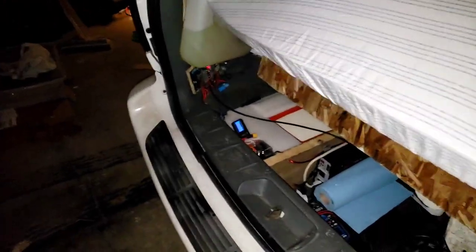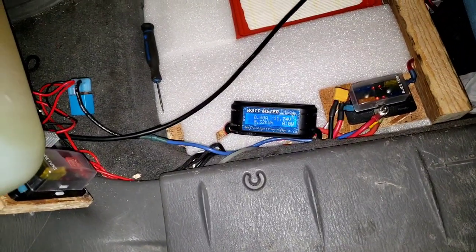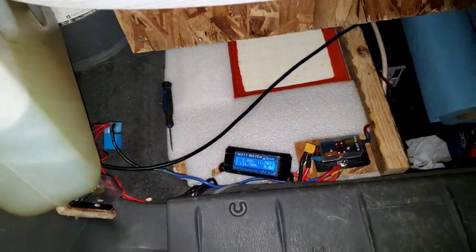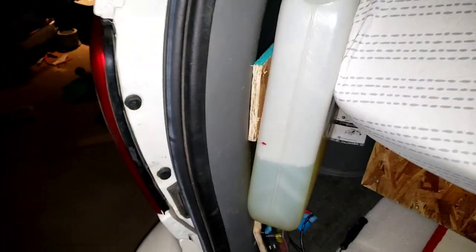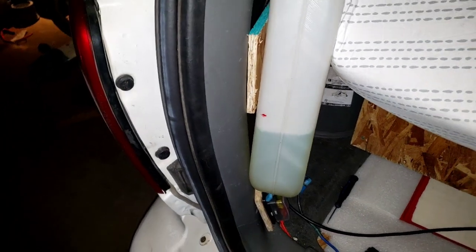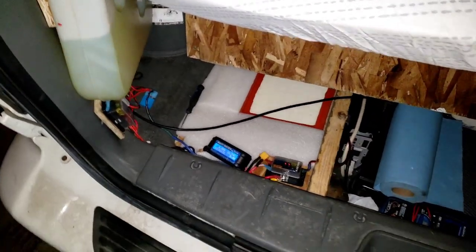I'm home! When I left I was at 10.8 volts and now I'm at 11.74 volts after about a 65-kilometer drive. There's my fuel level — I started up here but I was at that level by around 5:30 or 6, and I ran the heater for probably 14 hours.